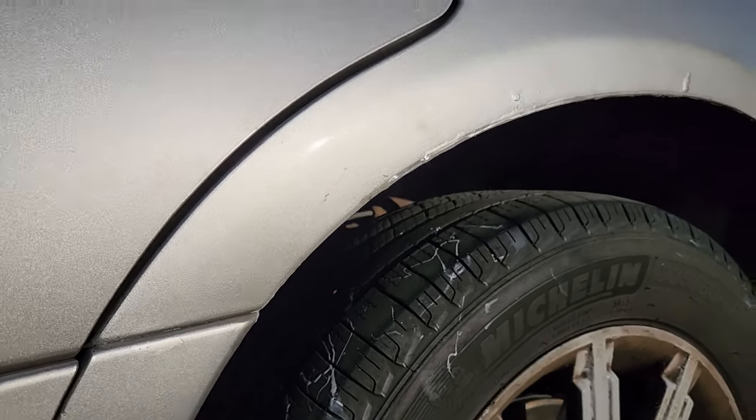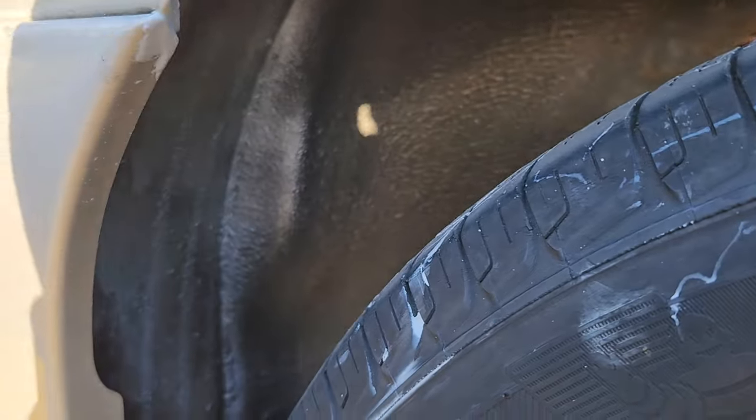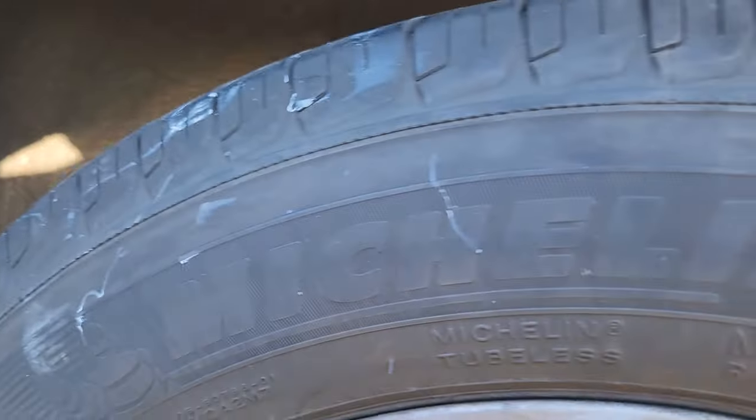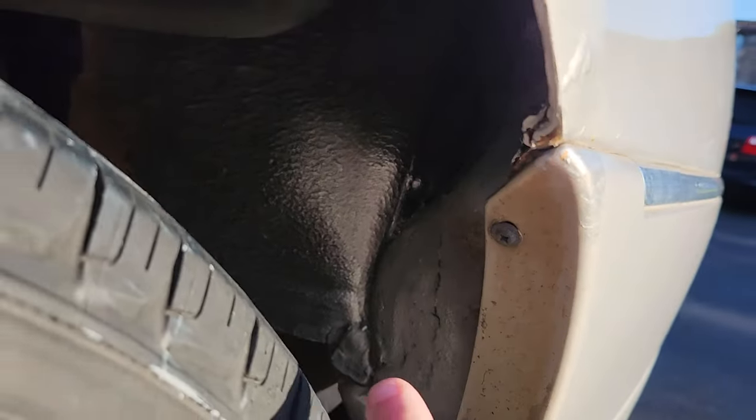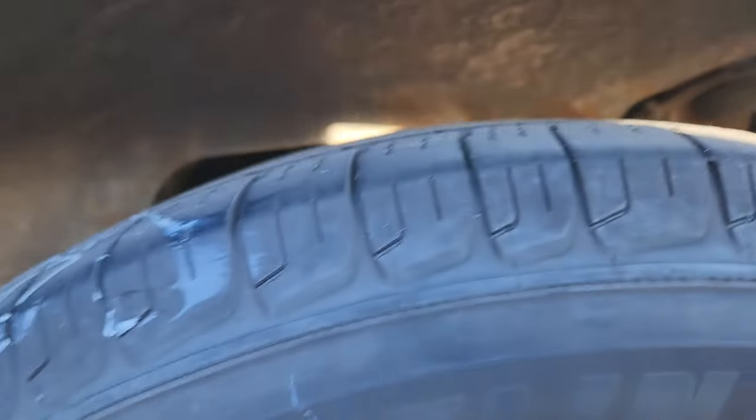There's some rust that fell onto the wheel and tire. Here's what I did: I sprayed some primer in there — you can kind of see the silver — gave it a few minutes to dry out, and then I just went beast mode with Flex Seal, packing it in there as much as I can. I also have some metallic paint that I sprayed in there just to give a little more layer of protection, and then I tried to work my way around the edge to cover it up. I have no idea if it's going to hold or if I made anything worse. I'm obviously not trying to pretend like I fixed the rust problem — the rust problem is definitely not something within my ability to fix.